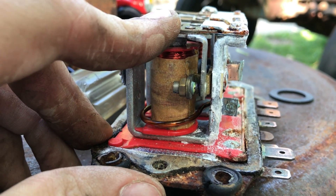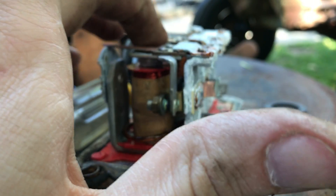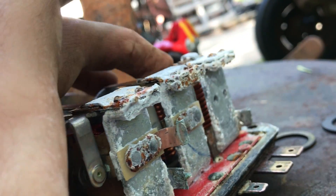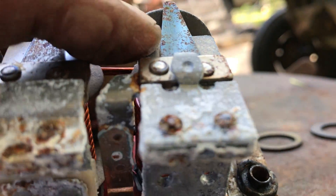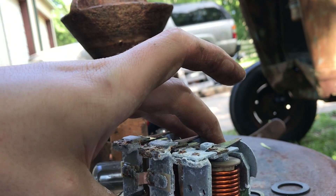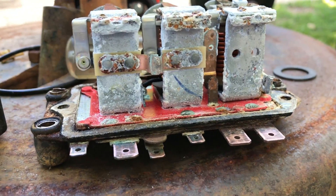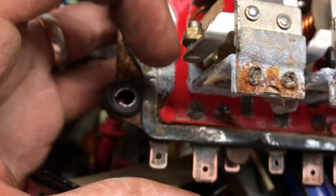What this regulator does is it brings down and breaks contact — probably when it's charged up enough. We've got three little sets of points we have to clean and make sure they make contact. I took a little file to all the contacts and cleaned them up until I got continuity. I finally got it to where all three are making contact.